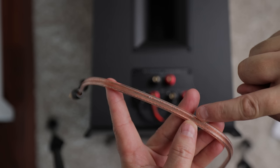If your speaker wire isn't color-coded red and black, it likely has a small line or writing down one side. I've always used the side with the line or writing as the positive red cable and the other as the negative black connection. Truthfully it doesn't matter which side you use for negative and positive — just make sure it's the same connection on both the speaker side and the AVR or amplifier side.